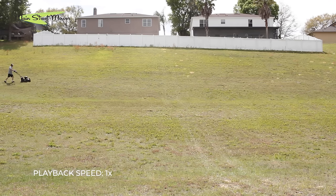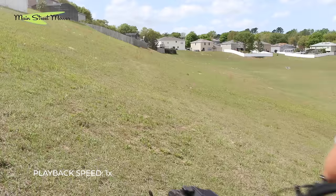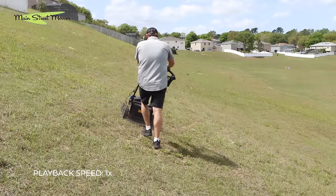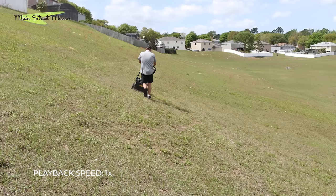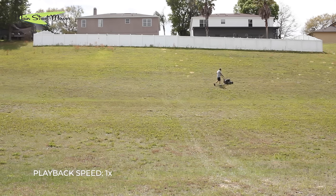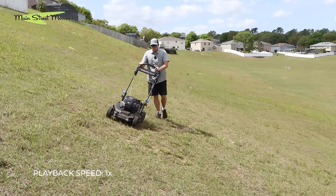Push mower again at 18 degrees — same story. It worked, chugged along, gave you good traction, and would even go uphill just fine. You got to have rear wheel drive. Look how the front wheels are coming off the ground — if it was front wheel drive, it wouldn't be pulling worth a diddly. Whoever thinks front wheel drive is better is wrong. If you are using a push mower, you are popping wheelies constantly — you want the wheels on the ground to have traction.